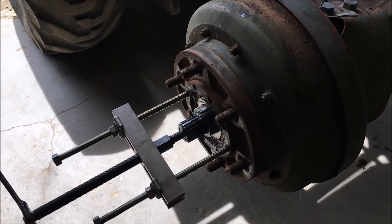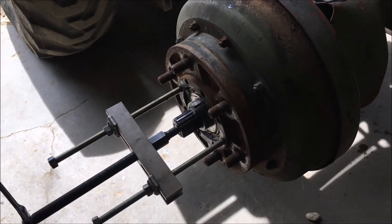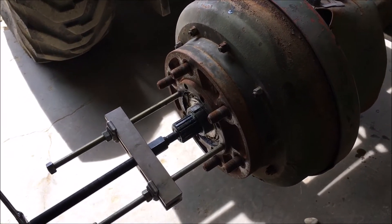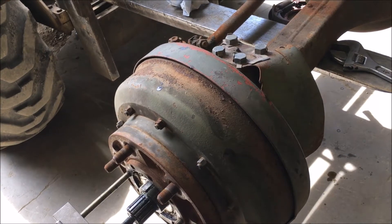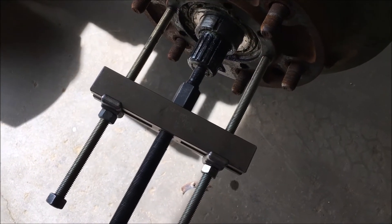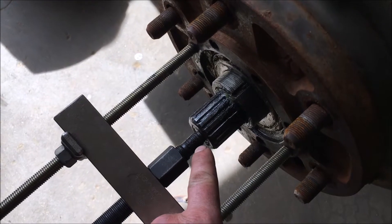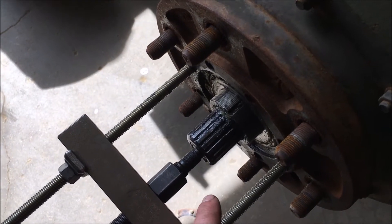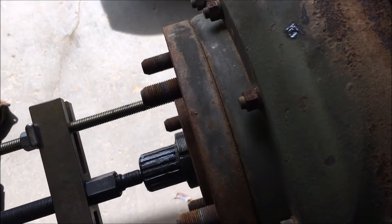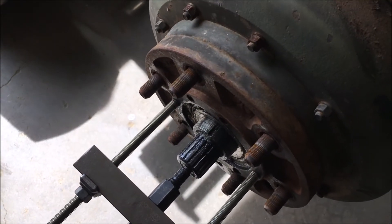When it comes to pulling these brake drums off, sometimes you get lucky and you can wiggle it loose and it'll slide off. But a lot of times if there's a little rust between the brake pads and the drum, you'll have to use either a pry bar, hammer, or this setup I prefer — just an H-bar puller with two half inch chunks of ready rod, pushing against the end of the axle shaft. Before you worry about damage, the axle shafts do have a thrust on the back side, so that's fine to push on. The pressure it takes is very minimal — it just saves a headache.